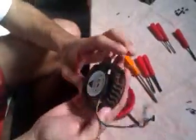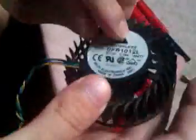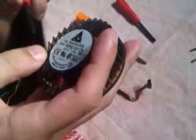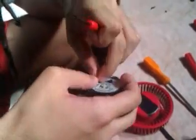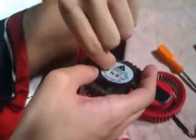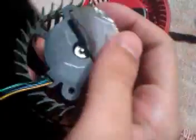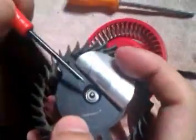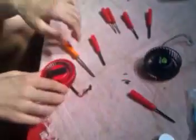This is the NVIDIA fan. As you can see, it's a Delta fan and unlike this one it has an exposed bearing. You just need to remove the sticker, pour oil or grease — whatever you're using — in here, and you're ready to go. Reinstall it and your fan is ready to work.